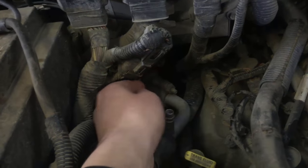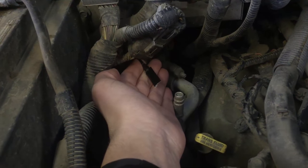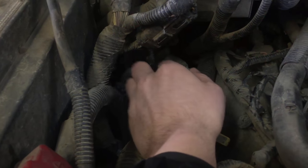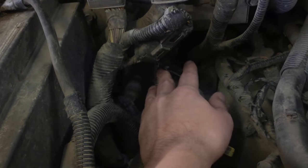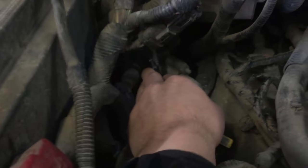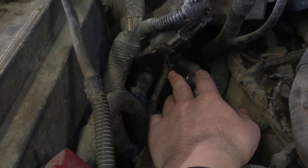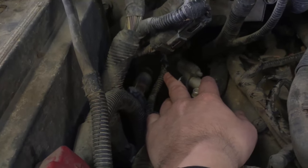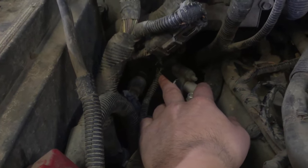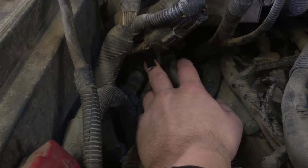This little thing right here — I don't know if it's on all trucks, but I'm pretty sure it is. I've checked one other truck and it's there. This is a vacuum line and it leads to absolutely nothing. It comes out of your air conditioner system harness, and it doesn't go to the air conditioner system. It was off on mine, it's off on the other one. I don't know if they just pop off, but I plugged that and my problem went away.